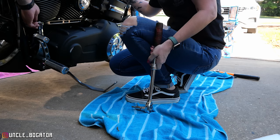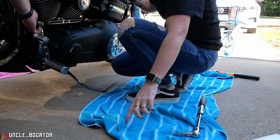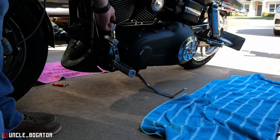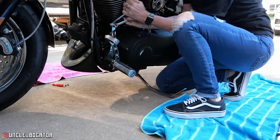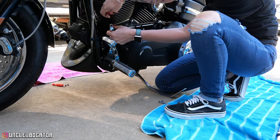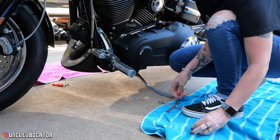What we want to do then is disconnect these. So find your wrenches. This looks like it could be a 3/8 or a 10 millimeter. Okay, so the other one, there's a little acorn nut here, so you're going to use the open side to hold that one. You see? There you go. Because these come with generic rods, I like to keep the ones you have on there if they fit, which they should. All right, now you can take the whole assembly off with the big ratchet.